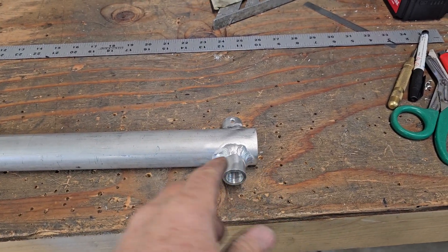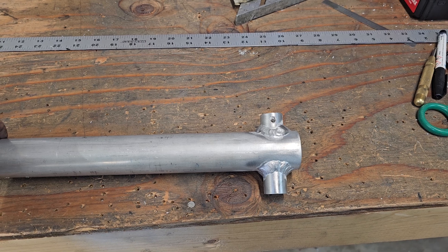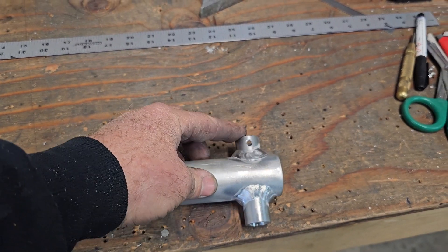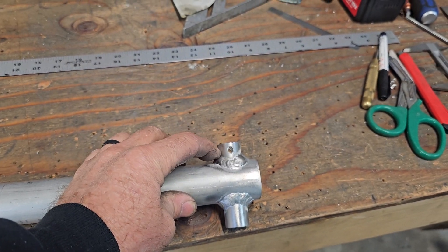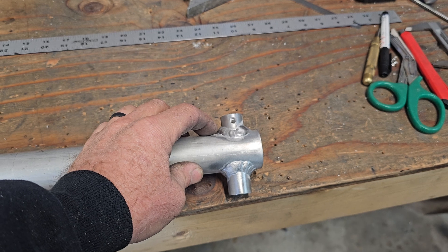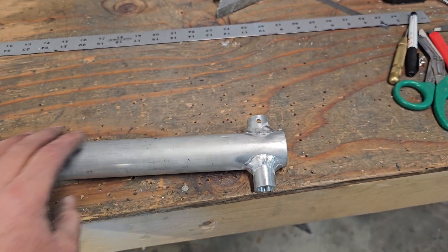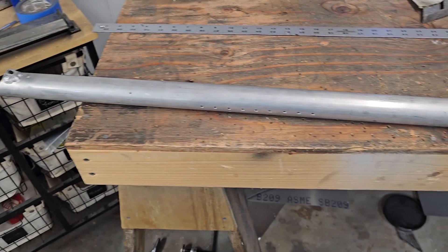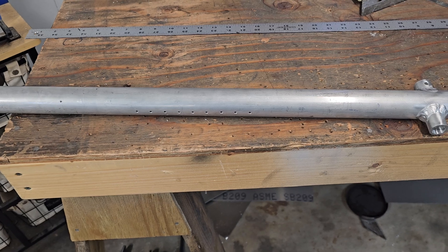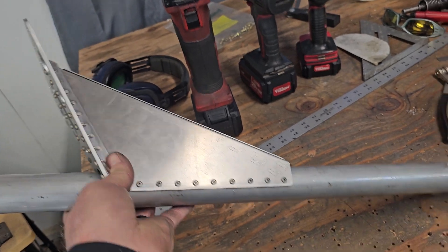What I've done is trimmed off the bottom. Looked at the plans, got the distance it's supposed to be width-wise, split the difference between the two sides — so this side is where it should be. There's a 3/16 hole there for an AN3 bolt that'll be the axle hold-down when completely done. This other side is still a little long — I'll leave it long until I'm sure what I'm gonna do with the brakes. Right now I should be able to rivet the gussets on for the mount and get it put in the plane.